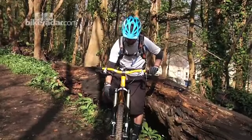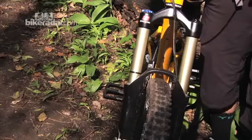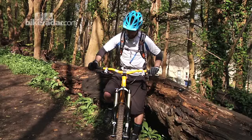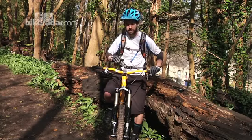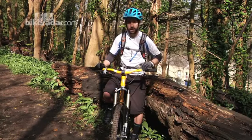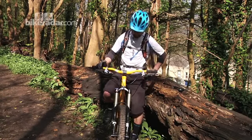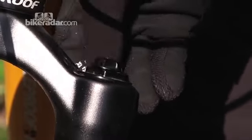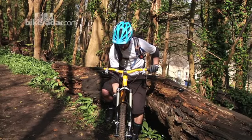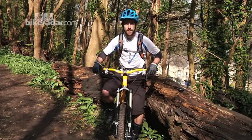As you can see, adding the air has really helped. We're up to about 50 psi now and we've got roughly about 20 to 25 percent sag, so we should be good to go. Obviously when you get back on the trail you may find that you need to add or remove a bit more air just to get the feel right, but only time will tell on that — it is partly down to rider preference. So I'm just going to put the valve cap back on and, knowing we're roughly about right with the sag, I'm going to remove the cable tie and get out riding to see where we're at with all the settings.